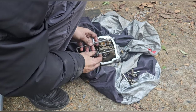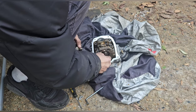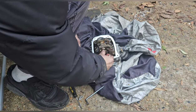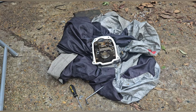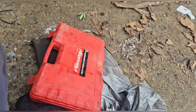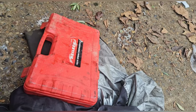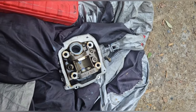Great, and we're down to the valves. We can use our valve compressor tool to pop them out. I'm not going to film this part guys, you've seen me do this before. Tools are cheaper nowadays. The only thing you might need to do is, once you've compressed it, if they're not popping easily, give it a little tap with a hammer.